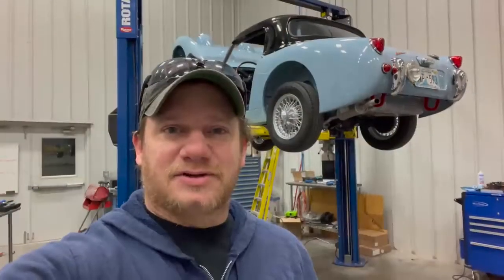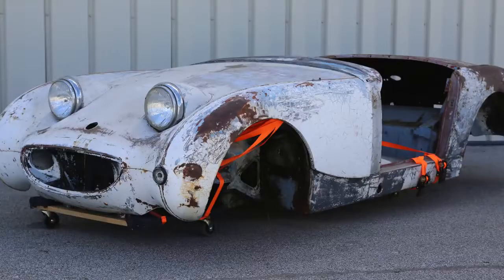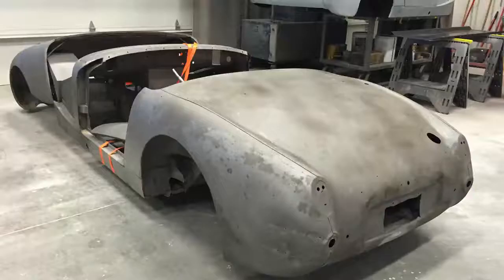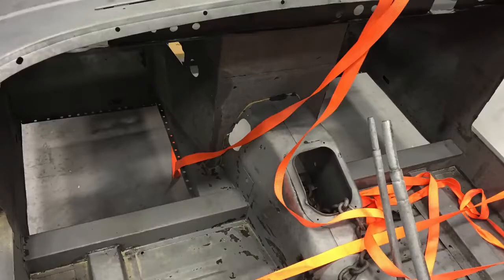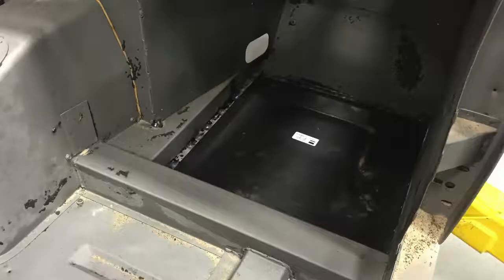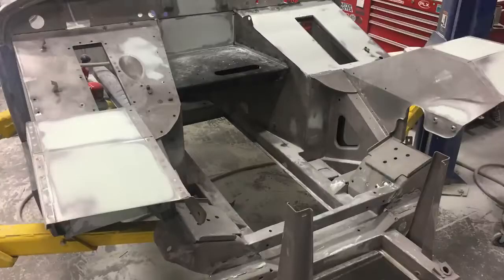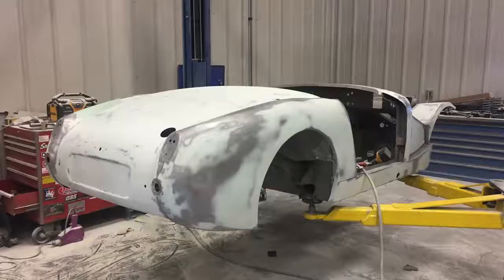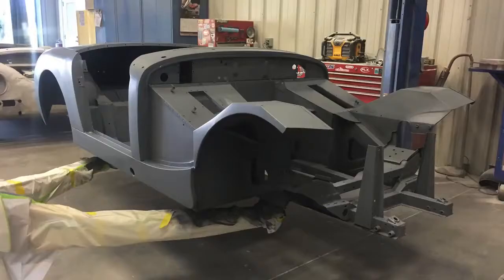Today's the day that the sprite's being loaded up and sent out to California. So what did it take to get this car to this point? Here's how bad the car looked when it came in — Ken had dragged it out of the Arizona desert, got it media blasted. Someone had modified where the pedals go; you can see that the floor had been cut out in areas. The car was just in really bad shape. We did only put front floor pans in it, so that helps out a lot. We always make this modification to the front frame rail — we clearance that for the crank pulley, gives a lot more room; you can slide a belt on and off without removing the engine.